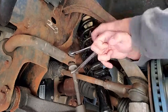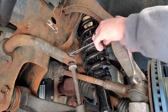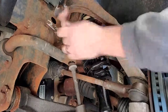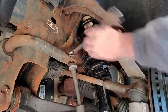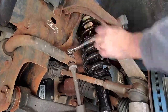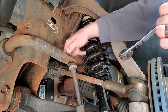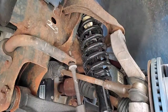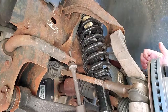I want to take it all the way off and pull my grommets out. If it's not turning, you don't need to hold it with the 15mm — you can just take the nut off. Now this will be a locking nut, so you do need to spin it all the way off; it's not going to come off with your fingers until you've got it almost to the top. There's a washer on the top that compresses the rubber grommet, so you want to pull that rubber grommet out. Now this side is loose, so I'm going to go to the other side and do that same process.